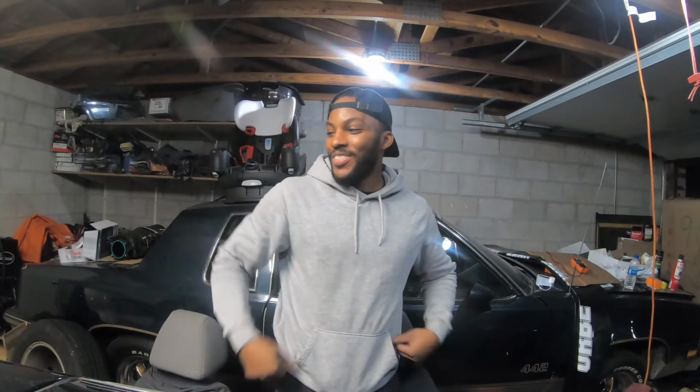My thing is, it started. It doesn't sound like it has any exhaust leaks. It ran smooth for the few seconds that it did run, and yeah. Oh man, I'm happy as hell. Okay, so I guess the next thing we got to do is go through the fuel system. So I'm probably gonna drop the tank, replace that pump, replace the fuel filter.